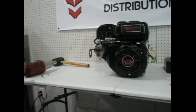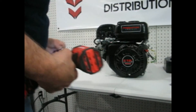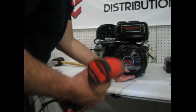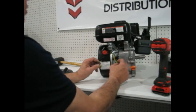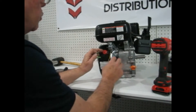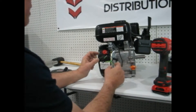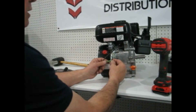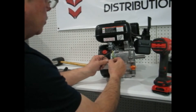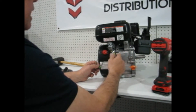Next we're going to remove the recoil starter. We are going to reuse that recoil starter, so pull it off and set it aside. Now the wiring — we've already disconnected it, but basically we're not going to use this switch any longer. The connectors are connected like this, and we don't want to grab the wires and pull because the connectors may not come apart and you'll pull the wires out. Just grab the two ends, twist a little bit, and get them off. Try to keep the ends on the engine because we are going to use those wire ends.